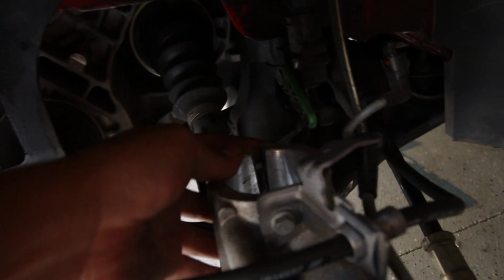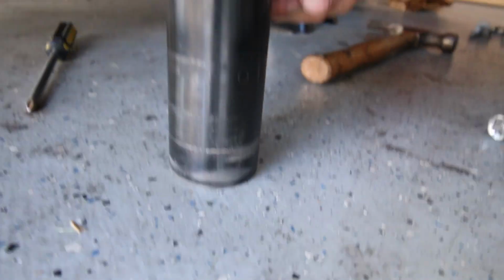All right, so first of all, I'm pretty sure maybe I'm just new to this because I'm new to Europeans, but Volkswagen uses a knuckle concept where the strut goes inside the knuckle. And basically you have to spread right here, this little gap, you have to put something in between, a flathead or a 1/4 inch ratchet, something just to spread it open. And then you can slide the bottom of the strut out. So this is the strut right here.